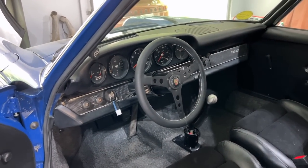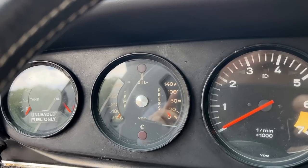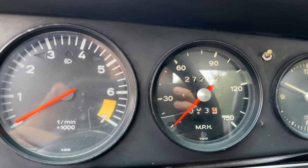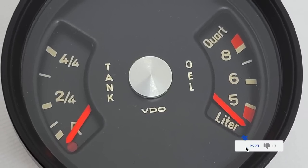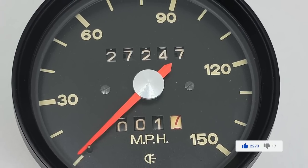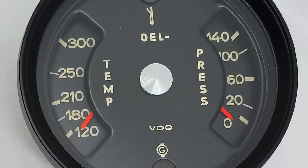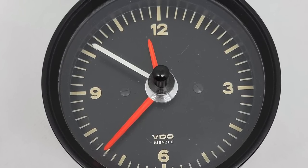Let's talk about gauges, because I am freaking psyched about these — any minute the truck may show up with them. As we talked about in the last episode, we talked to John Bell out in California, who does a lot of the custom gauges for Sports Purpose Garage. We were fortunate that I had a relationship with him and he had a bunch of cores I sent him, so he was able to build us a new set of gauges with the correct '69 ivory lettering and silver dots — all matching — new lenses, new bezels, the whole deal. We get a custom 10,000 RPM tach, and it's all set up to work off the XDI box. So in very short order these mismatched gauges will be replaced by fresh, correct-looking '69-style gauges. And no Aussie blue face on the tach — we decided against that.